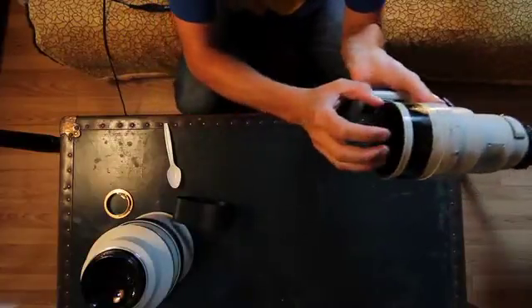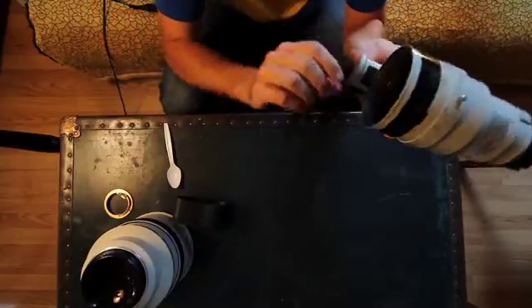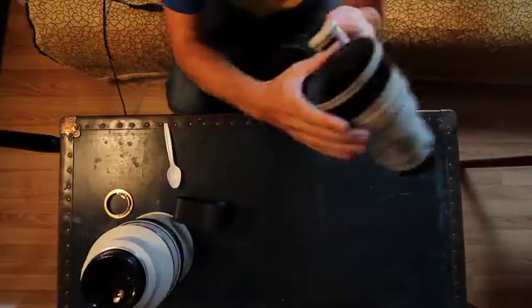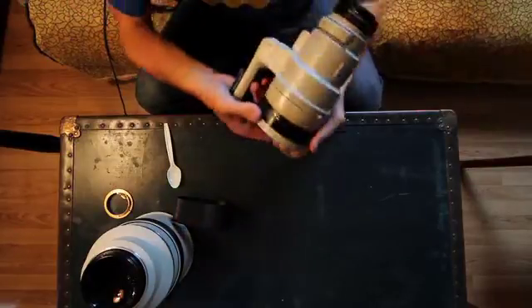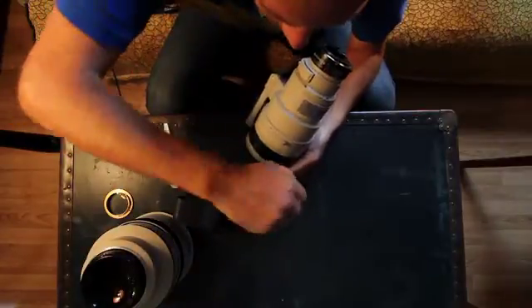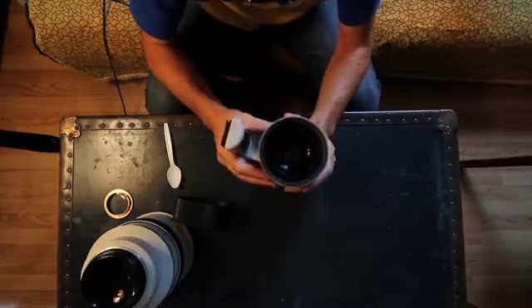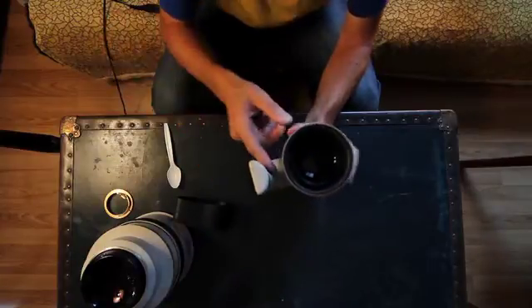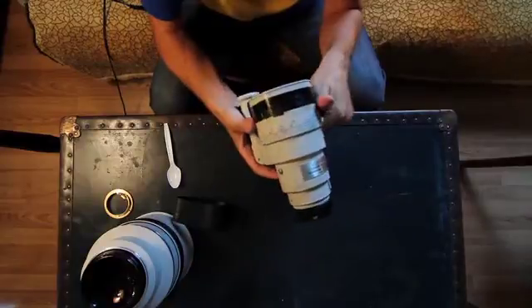Then you work upside down and shake it until that whole focusing element slips down. You'll need to retighten those screws. When you start tightening them — without putting new glue down, which I wouldn't recommend — those plates can get cocked sideways. What I found I had to do was put my finger in to counter the rotation of the plate, then get it tightened down. I managed the whole thing in less than two hours; if I had to do it again I could probably do it in half an hour.